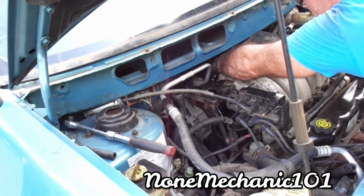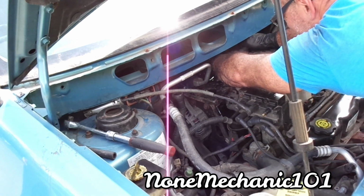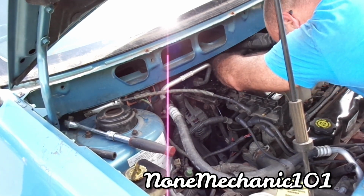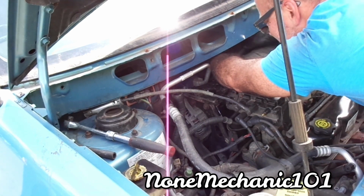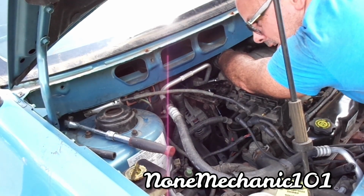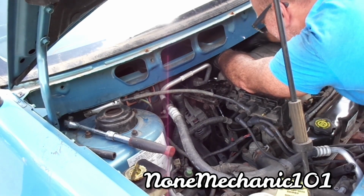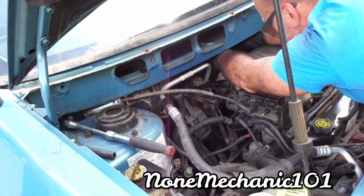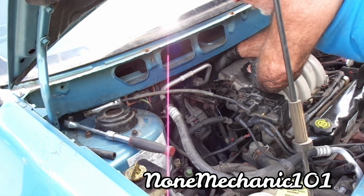And make sure it's straight. Hold it straight with one hand and just go easy. There you go. Push it down while you're turning it. You definitely need 3 little extensions, and you gotta put them one by one. You can maybe make it work with a long one, but you have to put them one by one because it's not gonna let the ratchet get in perfectly.